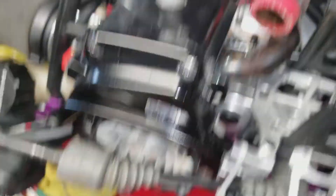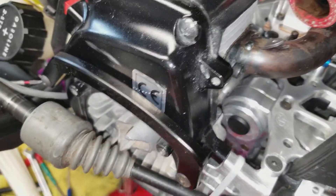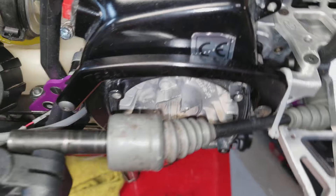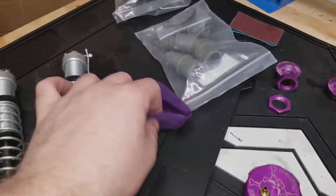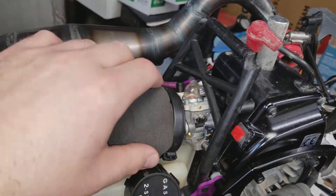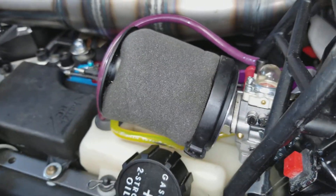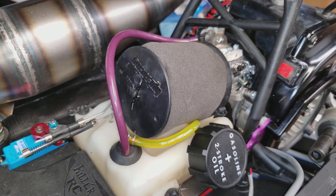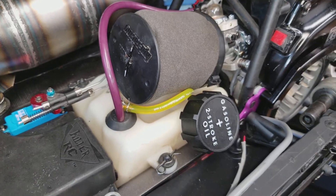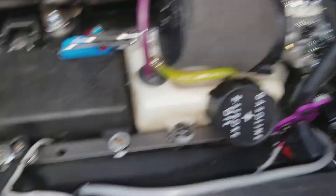This is just a piston stop. I'm going to find a brand new pull start or a rebuild — something actually better than the ones I have. For the air filter and pre-filter, I have one here. I need the other one for mine but I can give you another set of filters. This one is oiled — I just use Horizon Hobby oil. You can probably use canola oil or motorcycle foam filter oil. Bell Rays works pretty good too but it's kind of hard to clean off in the sink.